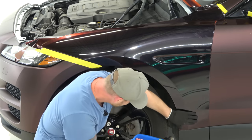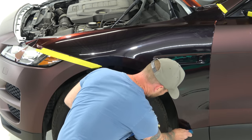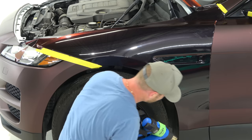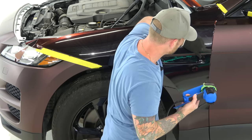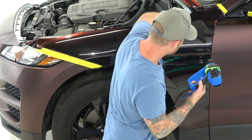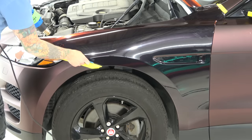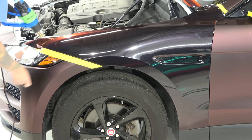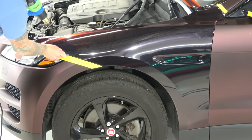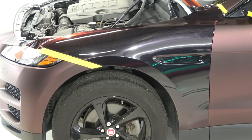Down here we're going to take the bottom section, heat it, then get in there with the buffer side first — tuck, pac-man style — and that's done. Right down at the very corner, heat that and massage it around. We're going to open the door eventually. I'm going to use the buffer side first. The screws are removed from the bumper, which is why it's a little flimsy — it's just clipped in right now. That's more or less all done for this section. Let's move the camera over and show you the corner, the inside edge, and the top corners.